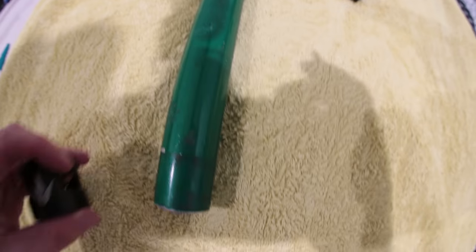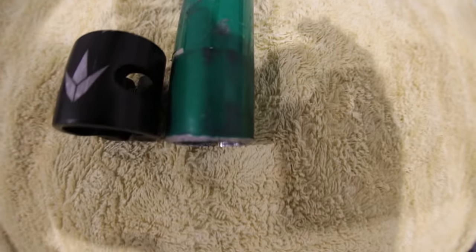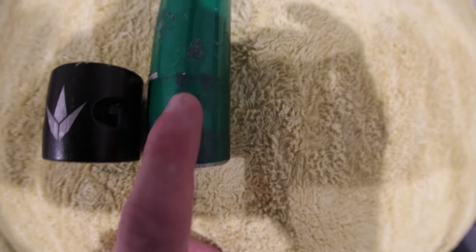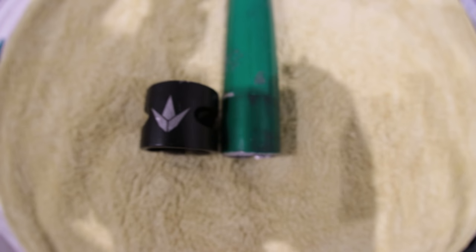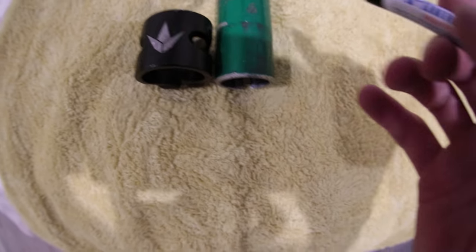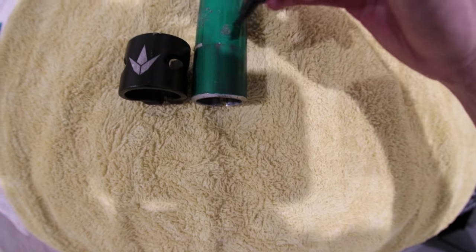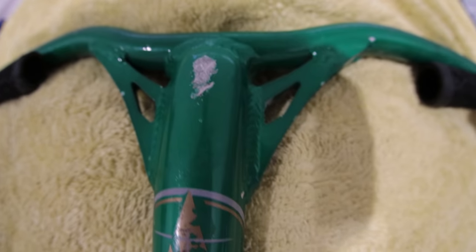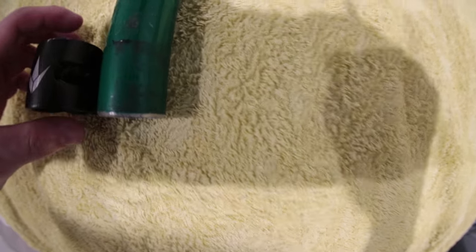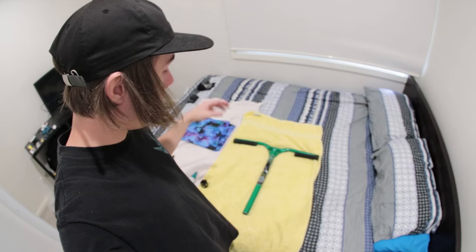So now we're going to come down the bars and go to the clamp section. We've got the clamp there — we're really lucky right now because we've kind of already got this guide. These bars have been used for quite some time, so there is a bit of a clamp impression. But if you haven't — if you've got brand new bars — you're not going to have this guide, so I'm just going to leave a line right there. That's where we want to stop with the bar wrap. It's not so important that you don't cross it on the crossbar, but with this one down here it's going to be really important, because if you do cross it when you try to put the clamp on, it's going to scrunch up and really mess up your job. Now I've marked it all out — let's get into the dirty work and switch to the GoPro.